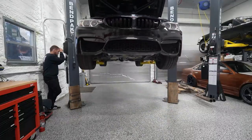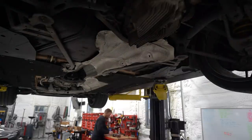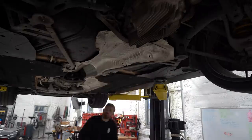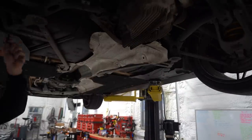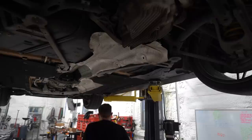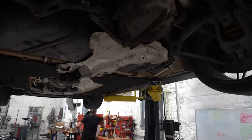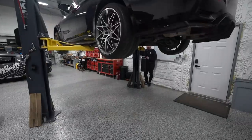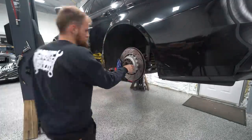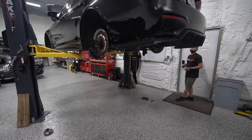One of the really cool things about these cars is that they are incredibly rigid — the chassis is super stiff for a car without a cage. However that comes at a cost: serviceability. To make the chassis that rigid there is a ton of bracing all over the place underneath and above, which generally has to be removed when you're servicing larger items like pulling the subframe or transmission out. So it becomes a bit of a multi-step process. I had to pull the plastics out to get to the bolts for the bracing to get the heat shield out, but all in all it was pretty accessible.